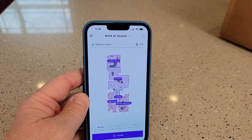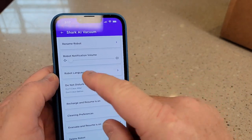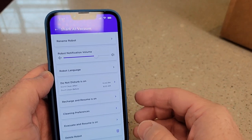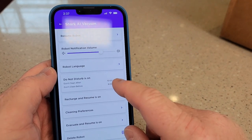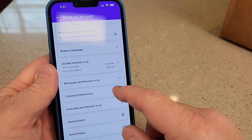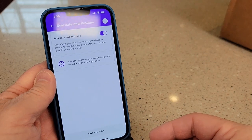These aren't really meant for a deep cleaning if your house gets really dirty — they're meant to keep it clean on a schedule. In the app settings, the robot vacuum will talk to you. The next thing is to put a do-not-disturb on, because if it starts cleaning at nine and doesn't finish, it'll charge and then go finish cleaning — I've had that start in the middle of the night. I have mine set from 10 p.m. to 8 a.m. Resume and charge is on. Also turn on evacuate and resume — if your house tends to be dirty, it'll make more trips to evacuate itself and then continue cleaning.